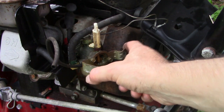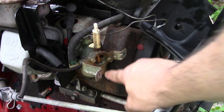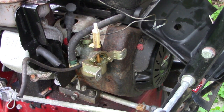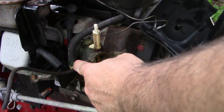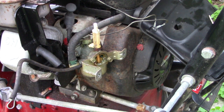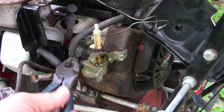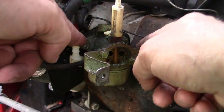Now we're looking at the carburetor pretty good right here. Fuel line coming from the gas tank right here, carburetor bowl right down here. I looked in the gas tank — it does have liquid in there. Again, it could be fuel, it could be water. I'm going to drain out the whole thing, disconnecting the fuel line from the carburetor right here with that clamp, and I'm going to let all of that gas slash water, whatever it is, drain away.